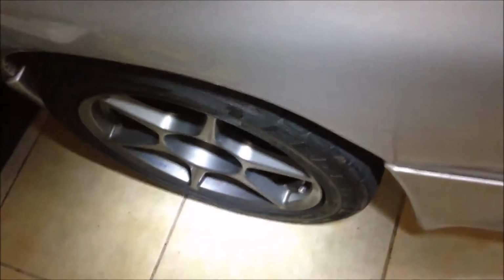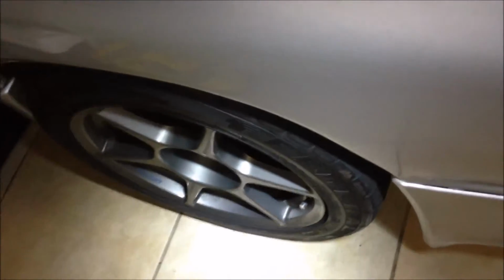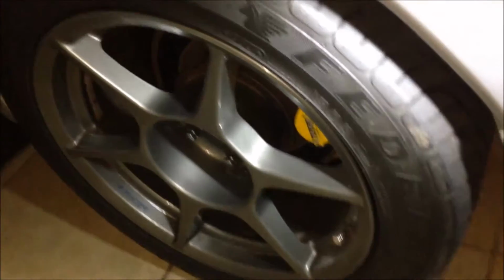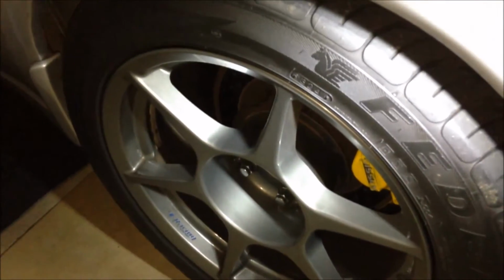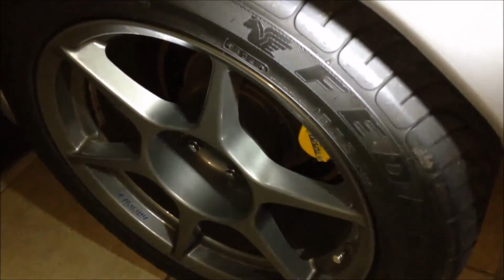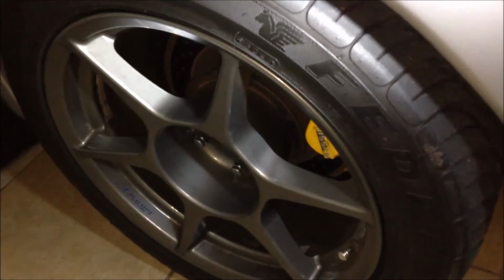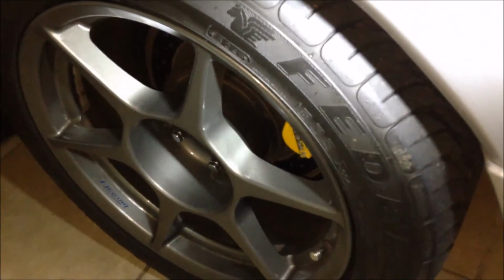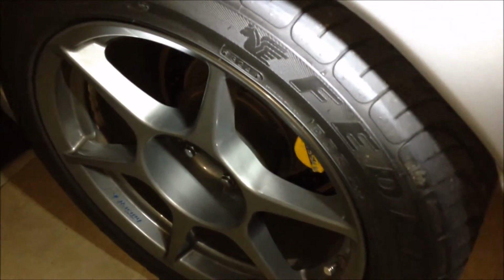So next item I want to talk about is tire pressure. Obviously, better branding of tires would help. I'm currently running Federal RSRs 595. I've been told best to run them at roughly 25-26 psi on the rear, so that'll be roughly about 1.6 to 1.7 bar. I am going to run the front probably 2 bar, between 1.9 and 2 bar. That's 28-29 psi. See what it'll do.